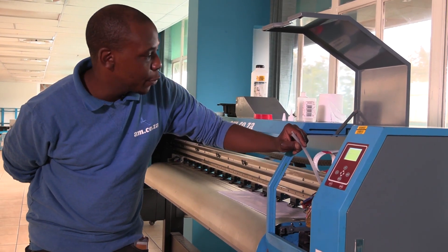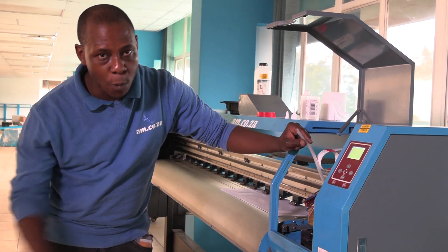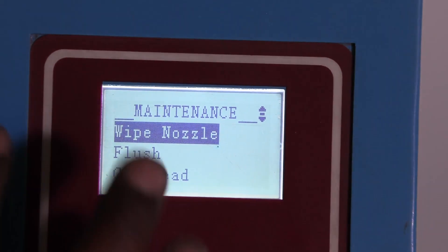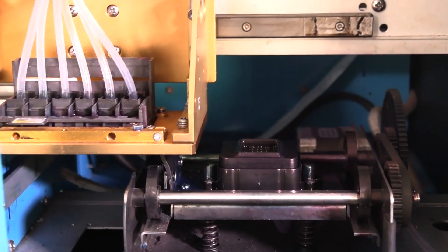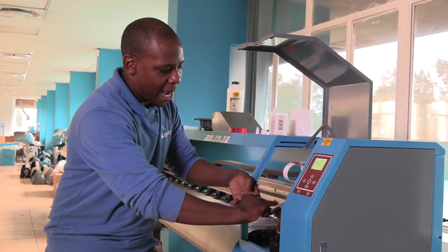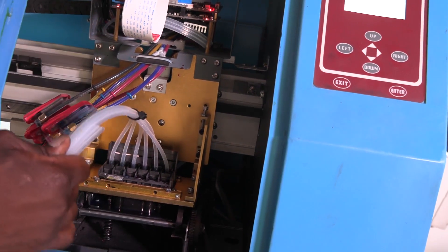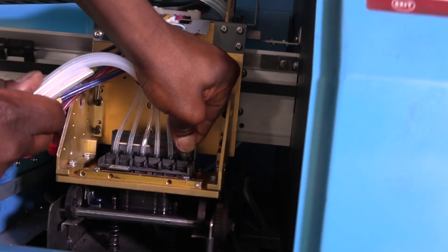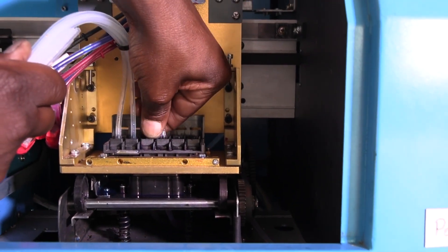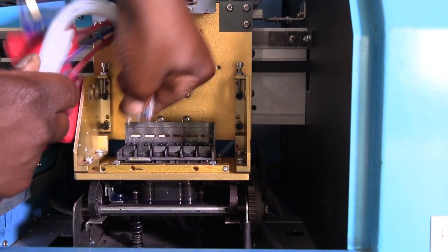Once the Epson shipping liquid has gone through into the head entirely, run just one more wipe nozzle. Then fold the pipes to stop the pressure if there is any liquid still left in the pipes. Now pull out the pipes from one side — either starting from your left going to your right, or from your right going to your left.